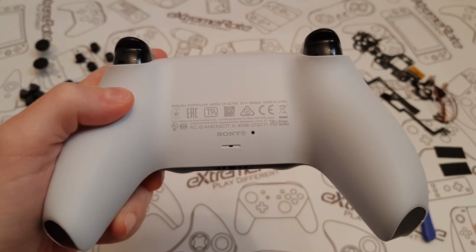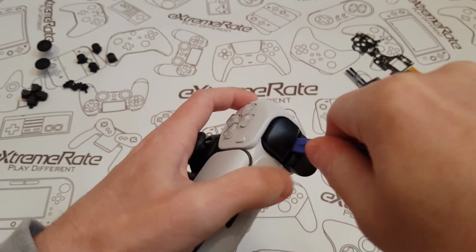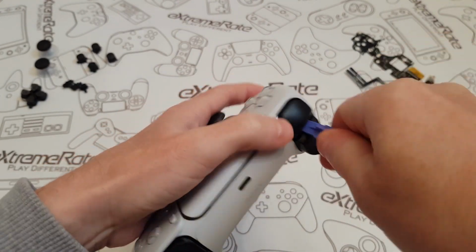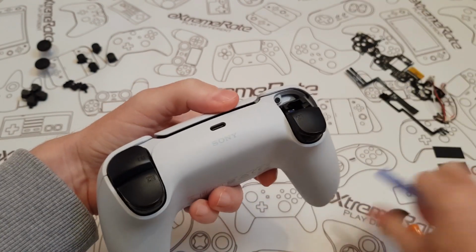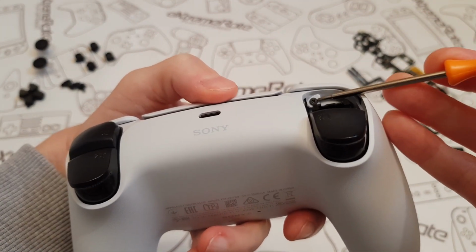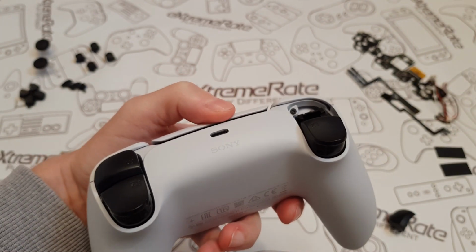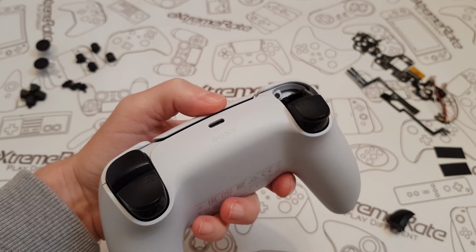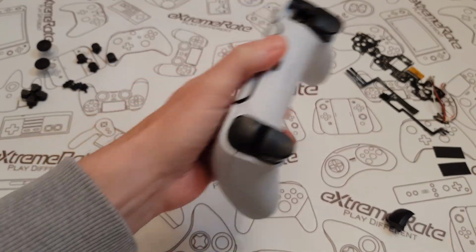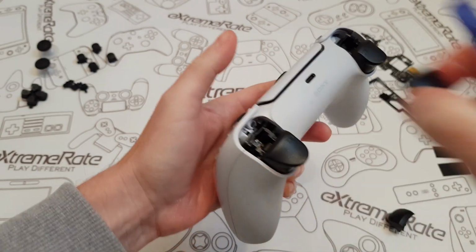There's another way as well, if I zoom out there. If you remove your R1 or your L1, the way to do that is get your prying tool, put it underneath here, and just turn left and right. And if you can see, this screw that's hidden behind here, mine's black, so that means it's a 10. If it's silver, it's a 20. The 30s, I really don't know. This kit is only for the 10 and the 20 as far as I'm aware, because a few of my subscribers have got in touch with us and said that a 30 came out now, so I'm really not sure on the 30.